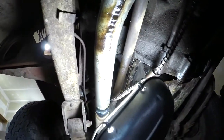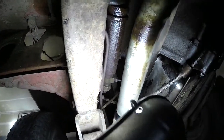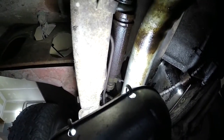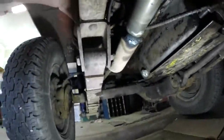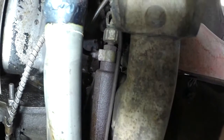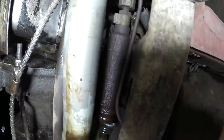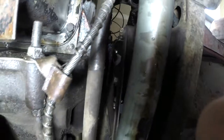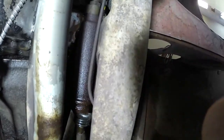There's a couple of bolt holes on the side holding it on — I think I can get those better from the top. From the bottom down here I'm going to have to try to manage to get the two brake hoses coming off that end. Upon further review, changing my perspective a little — one, you can see where it's leaking out real bad at that end. Two, there's only one brake line that comes off of there. If I can get that one disconnected without stripping it, I can probably get these two bolts off the side pretty easy, and then I think this plunger just drops out — maybe pull it out the top.